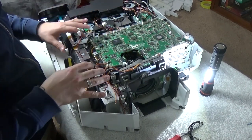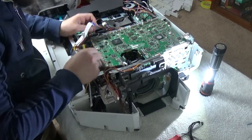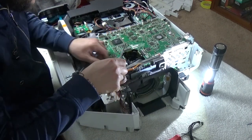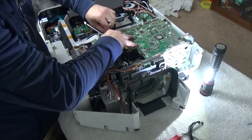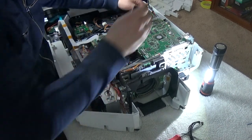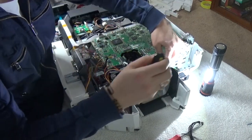This ribbon cable goes to the back - this power connection might be for the electric cooler, which would make sense: one side gets cold, the other side dissipates. Maybe we can even remove the cooling system intact. We've got labels: LV2 fan, level 2 fan, another fan, what looks like a heat sensor. There's also a label that says PS2 - I don't think they mean the standard German small DIN pin connector, but if so it could be an input for a keyboard or mouse, or some special configuration.